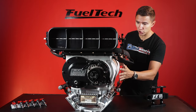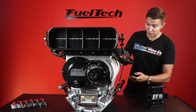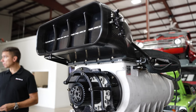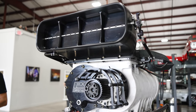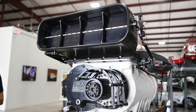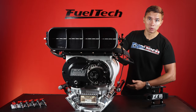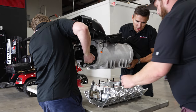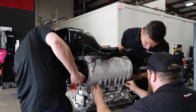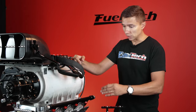This big chunk of metal — in this particular case, magnesium — tries to grab air from outside, squish it through different stages inside, and push it down. When it pushes down, it goes to our third main piece: the intake manifold. The intake manifold is the way to match this big chunk of compressor to whatever engine you have — small block, big block, Hemi, you name it. The intake is the one that does that job.